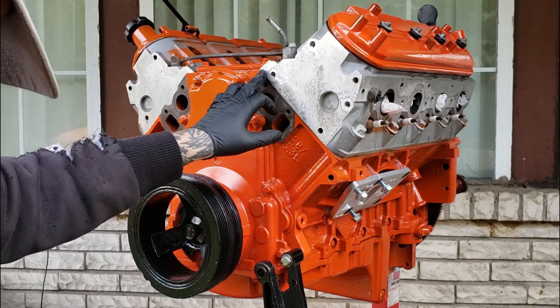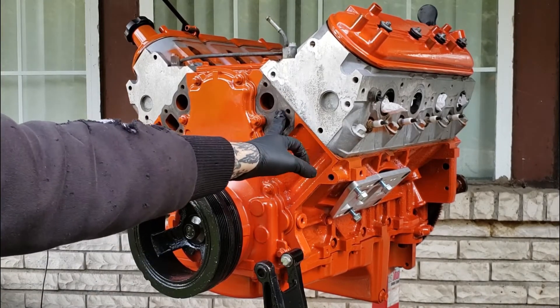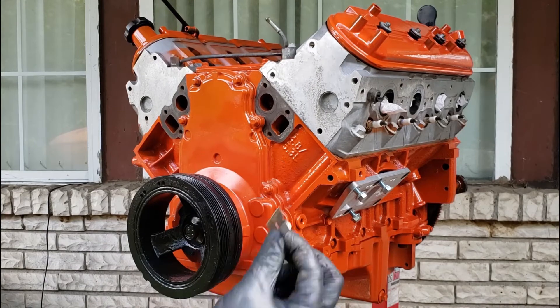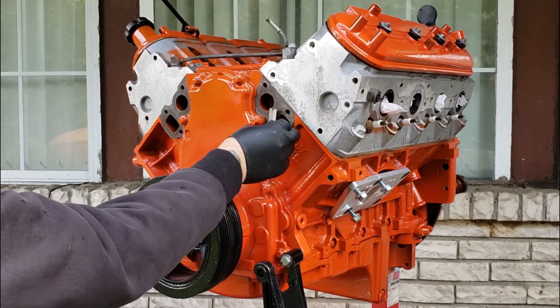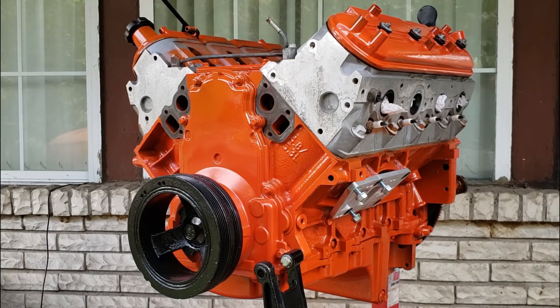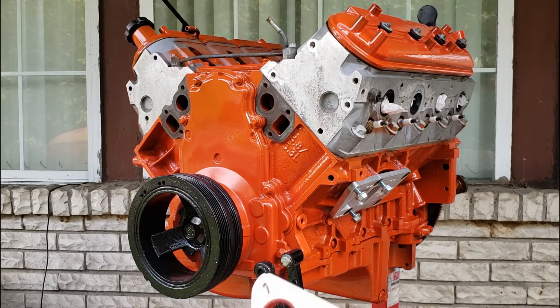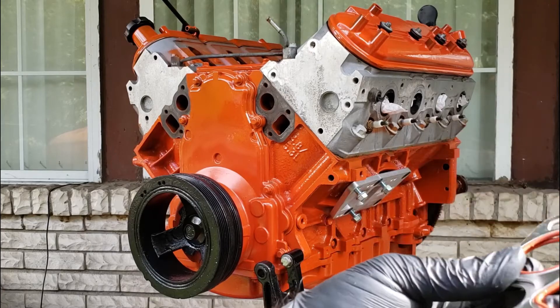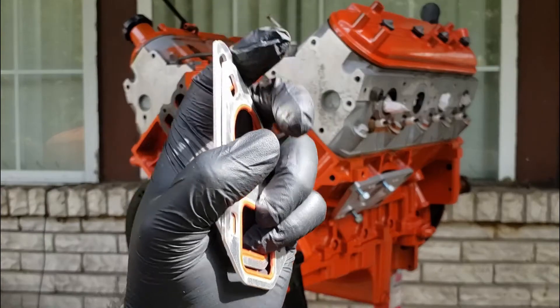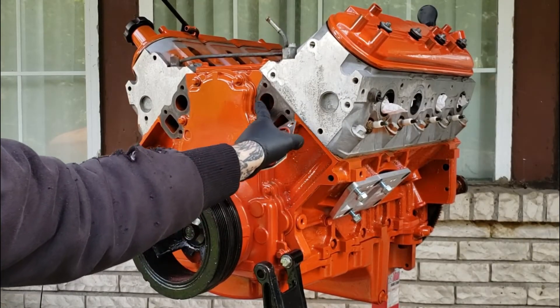You want to clean the surface. You can take a razor blade and scrape your old gasket off — you do not want to gouge it, just take your little razor blade and make sure it's nice and clean. If you're installing a new water pump, it will also be cleaned. If you're using your old water pump, you need to do the same thing to the backside and clean the gasket off of it. I highly recommend this style gasket over the paper ones — this is an updated gasket for what you find on Gen 4s. You can tell this is what was on this one by the O-ring mark here.